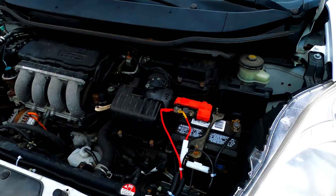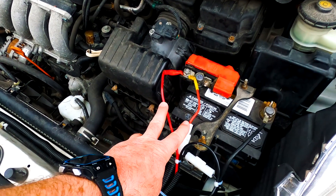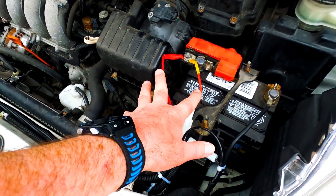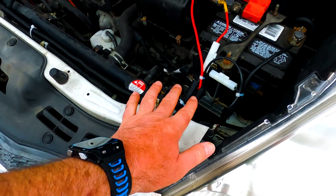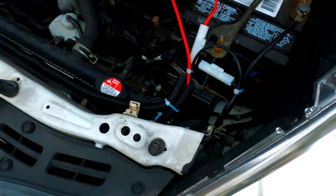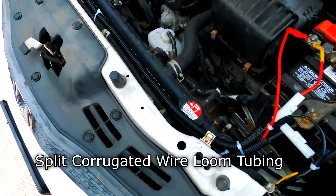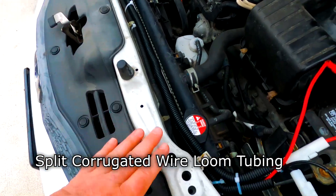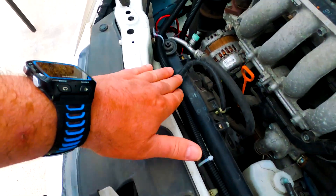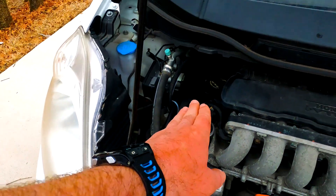This is an update to my previous car install. I've got two radios coming in here and if I had planned it out better I could have tapped in and had one source, but this is the power to one source and I've got two radios. This is the ground right here. I put everything in corrugated tubing - someone suggested that and I realized I better do that. I put both of these and tied them a lot nicer than they were. I had a lot of extra slack down there which I'm not sure what to do with, then I ran it through the firewall.